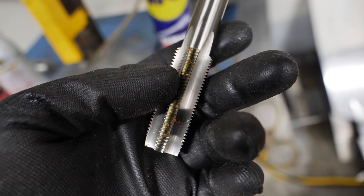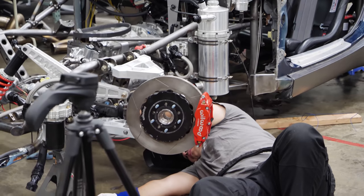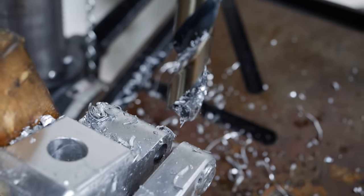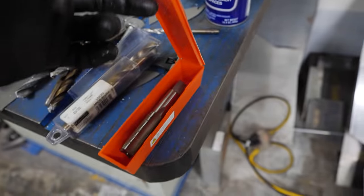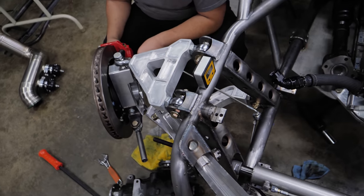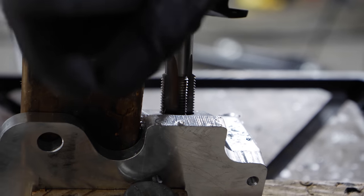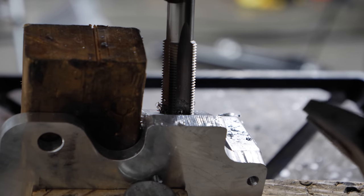This thing's huge. You at least need to get a drill bit that gets close to the inner smaller size of where the threads will be. Isaiah's working over tabs for mounting brakes. I just drilled an 11/16-inch hole — not with a hole saw but with a drill bit through a piece of aluminum — and it turned out really good. Multiple times I tried to constrain this from moving; wood is soft, so I learned a lot. Nice and smooth, ready for being tapped. Tapping this has been one of the most enjoyable processes — you get to use lube. Goes in, comes out. All the teeth I can just feel are spot on. There's been no binding.